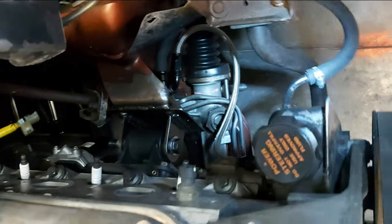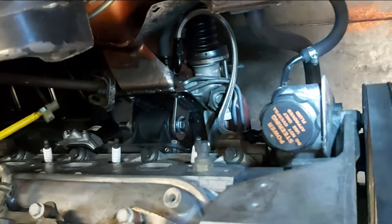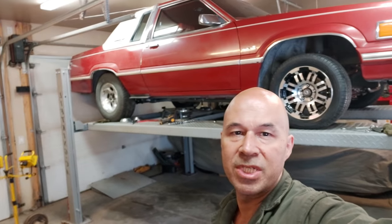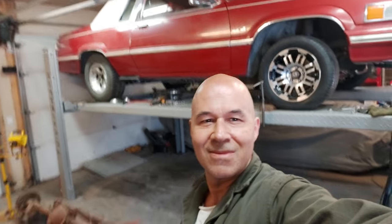So using a factory LS pump with the factory Mustang rack — or in this case the Ford Thunderbird. Pressure has been reduced with the pressure modifying kit as you saw in the earlier scene — a thousand PSI versus 1,350 that these usually put out. Hopefully that was a useful video. You might've learned something for Project Turbo LS power steering — LS or GM pump to supply pressure to the factory Ford rack and pinion. I'm going to work on the transmission crossmember fabrication and that'll be the next video. Thanks for watching.